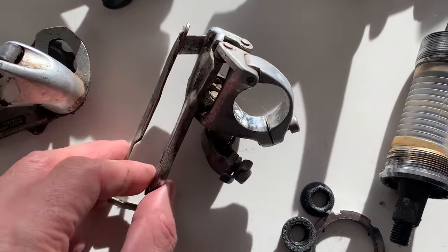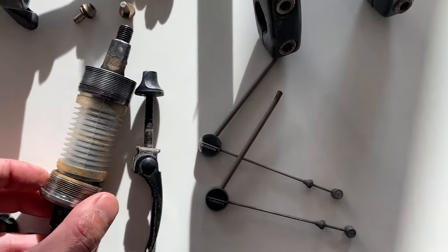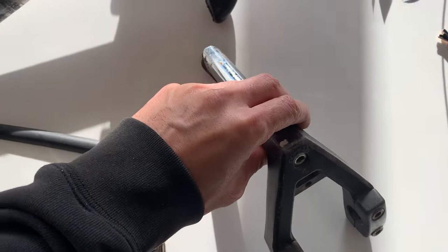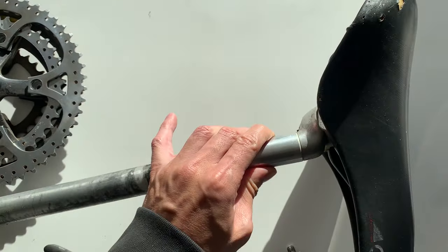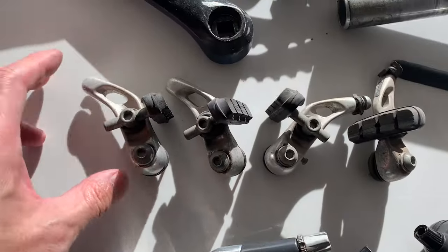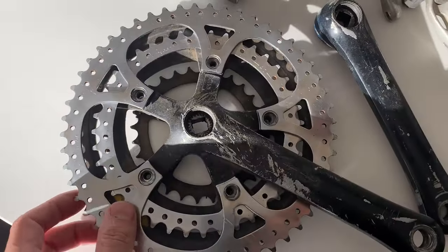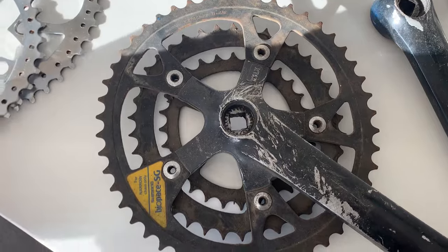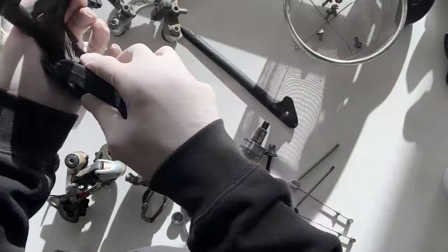The next thing I'm doing is cleaning up all these parts. You can see there's a little bit of rust. These bearings are pretty good, but I checked the spindle — the spindle was a little bit pitted, so I'm going to get a new BB. I've got a few spare lying around, so I'll see what fits. Here I'm going to replace the chain rings. You can see I got these two other ones I had lying around, but the teeth on the old one were pretty wrecked — pretty sharp-tooth-like — so I'm going to replace those.